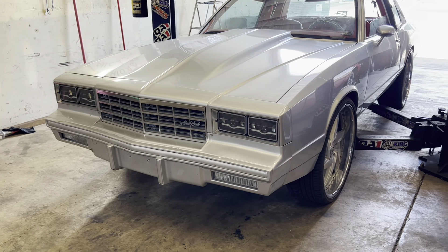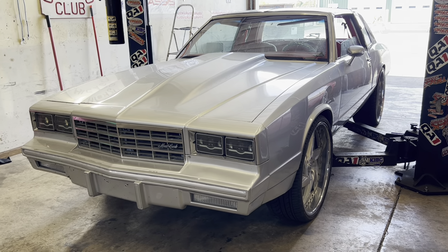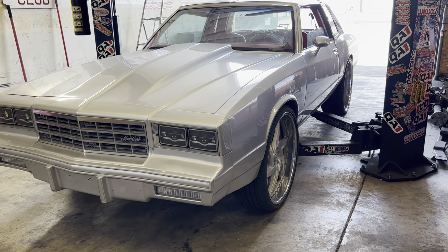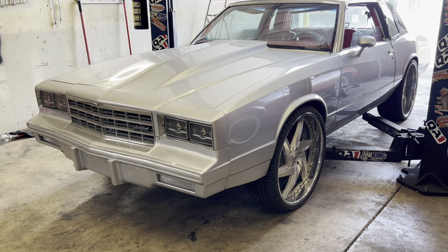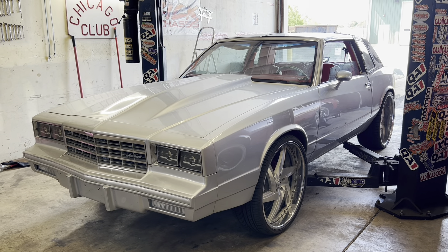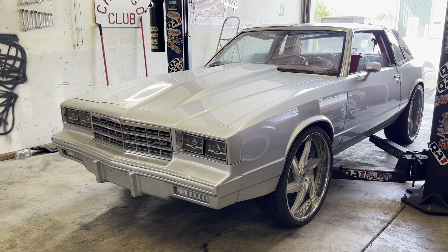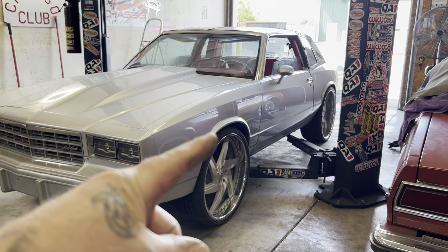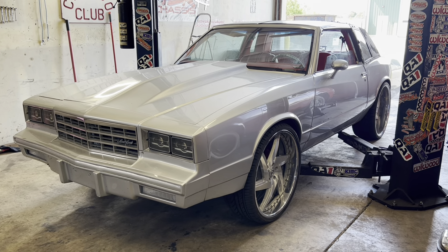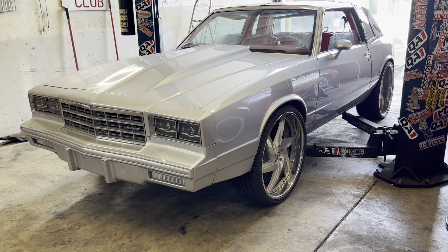The front of the car must have one of those level one, level two, level three setups — all that stuff, to me, don't work. It must have a level one, like a 350-pound spring in the front, which is not the correct rate. What happens is the front of the car will just keep falling and falling. You'll find yourself out there every other day twisting it up more, and then you'd have to reset your alignment. A bolt-on wannabe anti-roll bar on the back — weak, very weak.